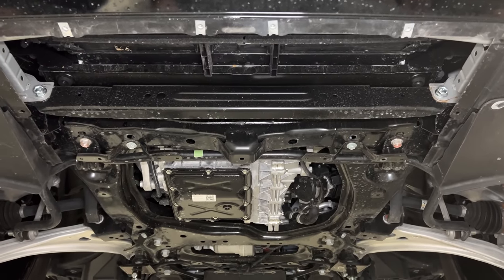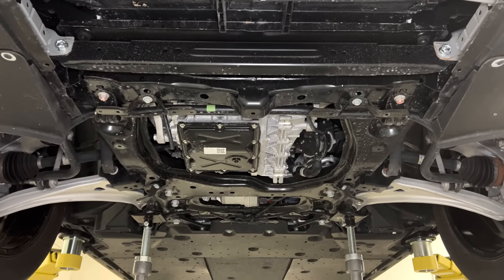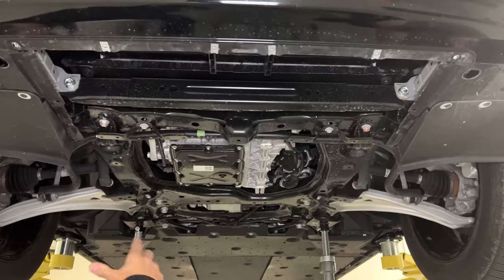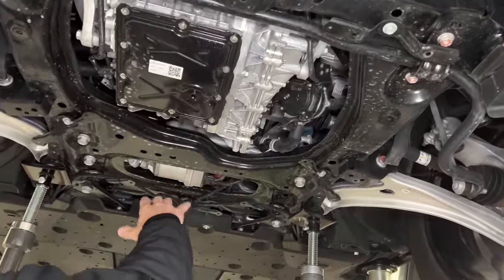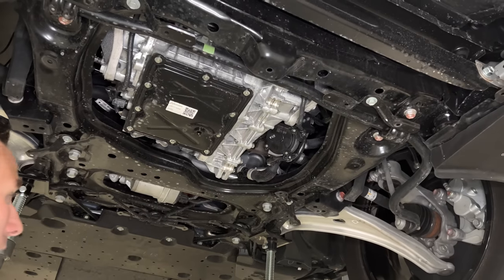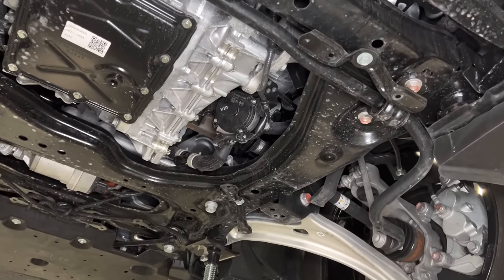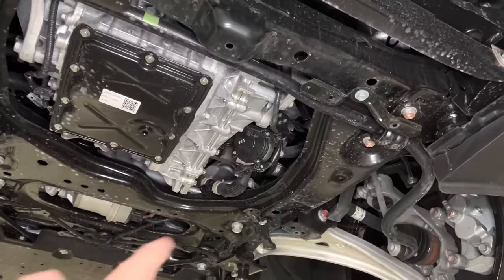Moving rearward, other than that, in terms of the suspension architecture, it's relatively straightforward and conventional. It's a stamped steel full perimeter cradle, meaning they do have a cross member fore, aft, left and right, so full perimeter cradle, the subframe here. It's a stamped steel weldment. It's decked in Z exclusively. They do a six-point, actually, they may do, yeah, no, it is a six-point mount.